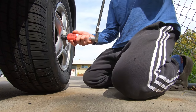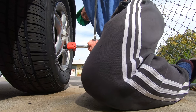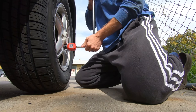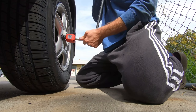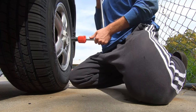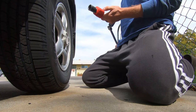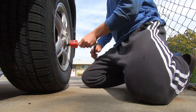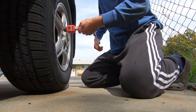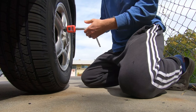Let's try these out and see if anything's weird: 78, 61, 68. A little unfortunate to think that if I wasn't doing this test I should have come back on my own regardless to re-torque the lug nuts. Maybe I just shouldn't trust them. It's a bummer, because now every time I get my tires changed I'm going to have to come back and torque them myself. 66 — that one's probably right on. And 68 — probably pretty good as well. Tighten them back down.